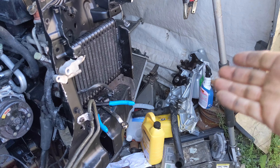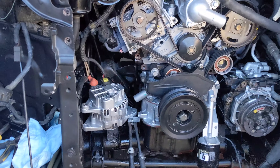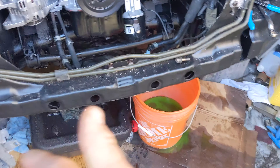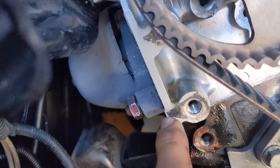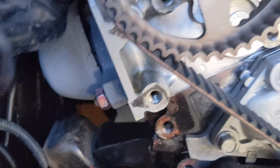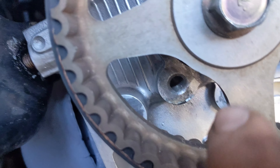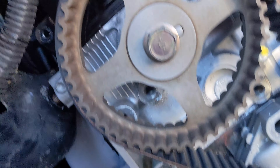Here's an update - I removed the service bracket and it didn't take me that long, about an hour. This was all disassembled, I dropped tons of oil and made a mess. You can see here that the leak came from the seal, landed here and all the way down here - there's oil there too. Look how far in the seal is - that's not where it's supposed to be, that's the reason why it's leaking. I ordered new seals.